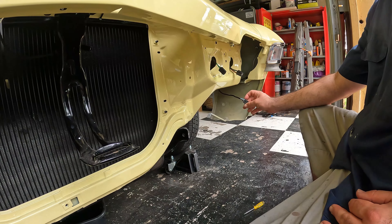We have horns — we don't have the horns yet but there are two horns that mount right here. We've got an orange wire for the electric fans which we may or may not use. It's actually pretty simple once you dissect it. A lot of people get intimidated by the wiring. The PSI harness has a spot for the fan wire. We were just talking about how much of the American Auto Wire we're actually going to use, because we're thinking we won't even use anything on the engine side — starter wire, ignition wire, oil pressure, temperature, wiper, alternator — all that's tied into the custom PSI harness.